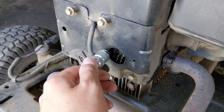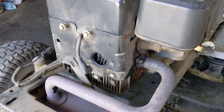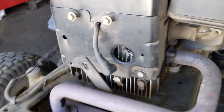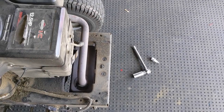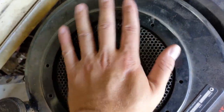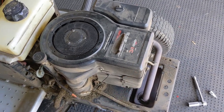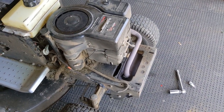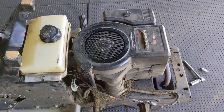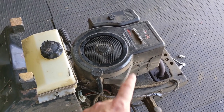We can remove the spark plug and have a look — sure enough, it's soaking wet with fuel. This way it will relieve all of the pressure in the cylinder when the piston comes forward, because we now have an escape port for all of that fuel to get out. With the spark plug removed from the cylinder head, we can spin the flywheel around just fine in the clockwise rotation, which we couldn't do before because that fuel wouldn't compress in the cylinder. Simple case of hydro lock.